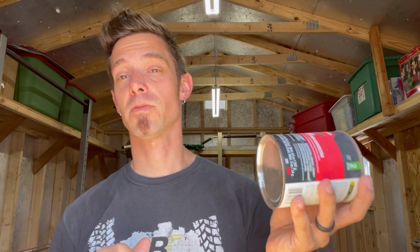But a lot of the times it cracks before you even know because it's actually shrinking. It can actually take up to 3 days for body filler to fully cure. So you really shouldn't put it on very thick. It's just like painting. If you put paint on super thick, it might feel dry at the top, but it's not dry underneath. So you touch it, you get a fingerprint. It's really the same idea.